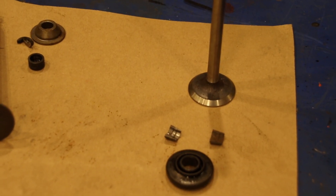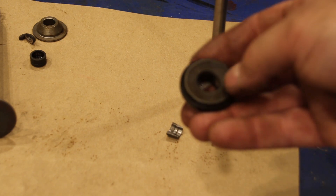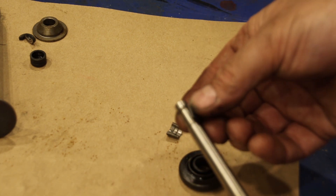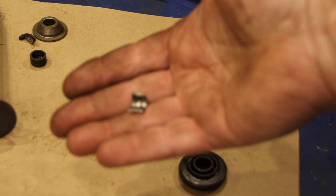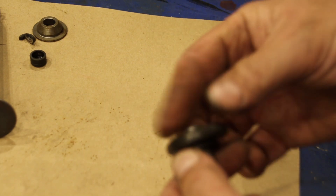On late M38s and on Bertram's engine — which has an RMC prefix, meaning it's a remanufactured engine that went into an M38 — they used the f-head exhaust rotator style. That's where it first came from. They used a valve with a completely different kind of keeper: the f-head style with very thin and differently shaped keepers. This was the final attempt at M38 exhaust valve rotation.